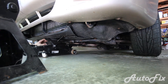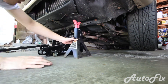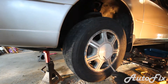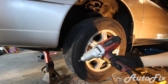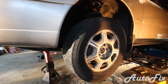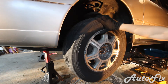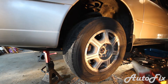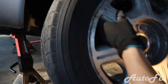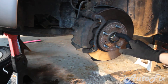All right, let's jack up the car. Now that the car is up on jack stands, let's go ahead and take the wheel off so we can get to the axle. I'm going to be using my almost brand new impact from Harbor Freight just to take the wheel off because it's faster. If you don't have an impact, you'll want to loosen the lug nuts before you put the car up on jack stands, otherwise the wheel will just spin. That's a 21 millimeter socket for the lug nuts.